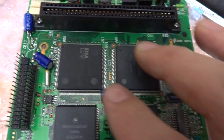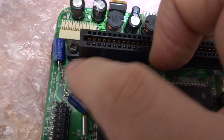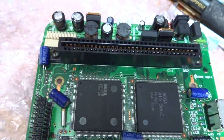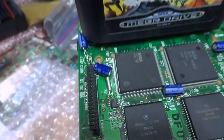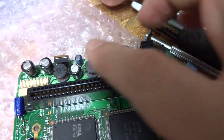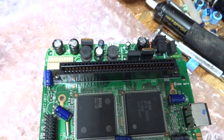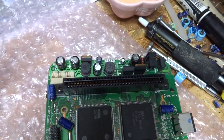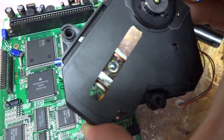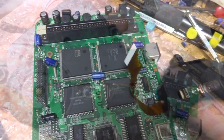Here we have the bottom board with all the capacitors changed out. There's a screw hole here so we couldn't put a cap there, and the cartridge itself sits down here, so I had to route this one to the side — the cart will fit in, it's really close but there's a little space. In the back for the power we've got those all replaced as well. Before we reassemble, we're going to look at the laser mechanism — clean it out and regrease it, it looks pretty bone dry.